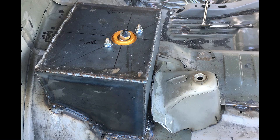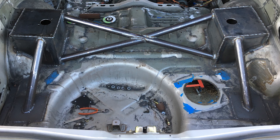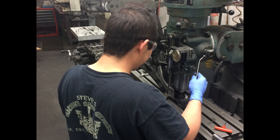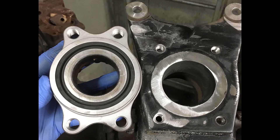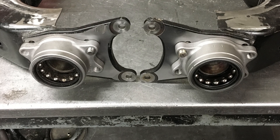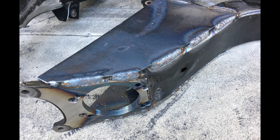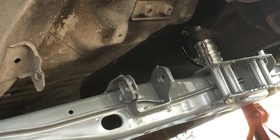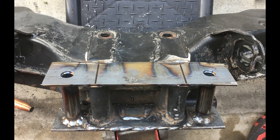For the rear, I fabricated my own strut tower mounts. The rear subframe is kind of touchy because I did a lot of work to it — I cut the crap out of it and actually converted the rear to accept S13 hubs. But after all the fabrication, I thought, you know what, an S13 rear subframe will go on much easier than all of this work I've already done. So that's kind of scrapped, besides keeping the S13 rear coilovers. Everything I've done to the rear subframe — I really don't like it, it's too sketchy.